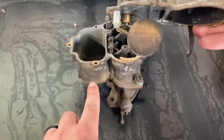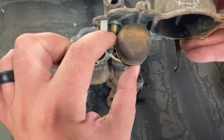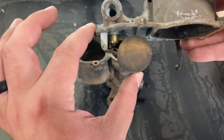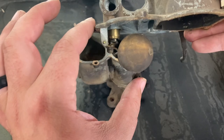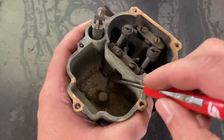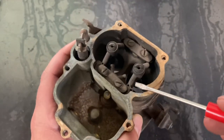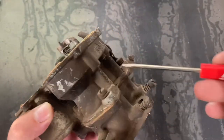It does that through this float. Once the fuel reaches the proper height, the float moves up and closes the flow with the needle and seat inside that casting. So if we were to kick over the engine, the fuel would enter through your metering jets down below, fill your bowl, go up and over your spray nozzles, and down the side of the carburetor.